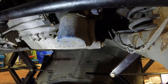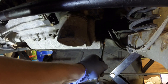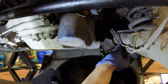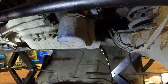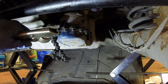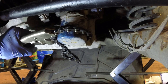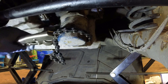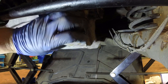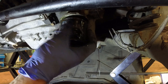Now we're going to give our car an oil change. You can see here I'm under the car — the oil filter is clearly visible and you can see where the drain plug is as well. The drain plug can be jammed on there pretty tight, so just be careful when removing it. The oil in this car was particularly nasty, so I was glad to be changing it. Once all your oil is out into the drain pan, you can go ahead and pull your oil filter — just make sure the pan is under the filter when you remove it. My filter was on pretty tight so I had to use a wrench to get it started.